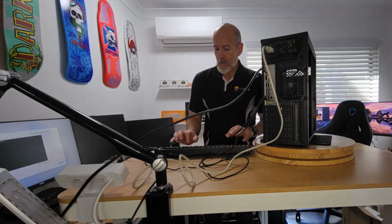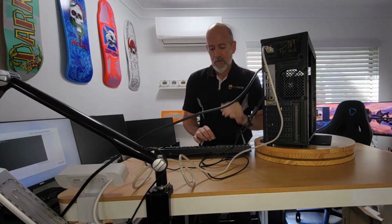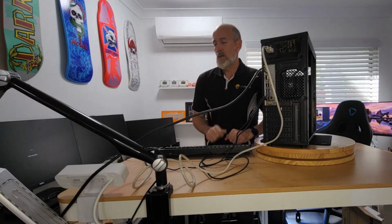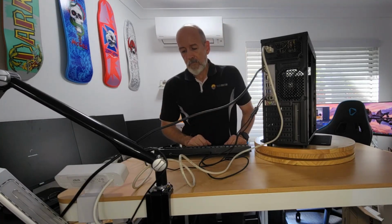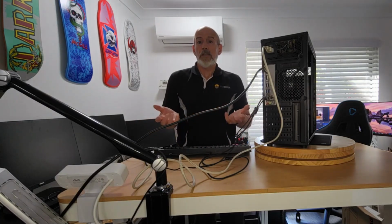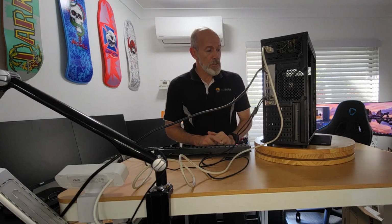Okay, so here I go, OOBE, backslash, bypass NRO. Return, that'll restart, and that does some voodoo behind the scenes, and then all of a sudden we can have a local account, and it's happy days. So once you know how to do it, it's not a big deal. It's just annoying that they make you do it.